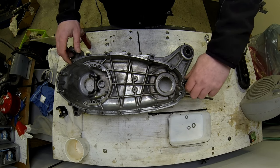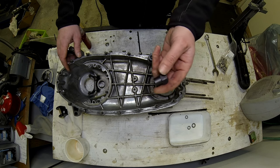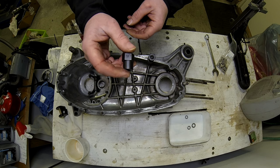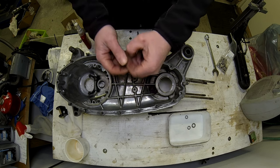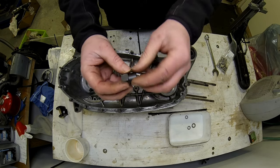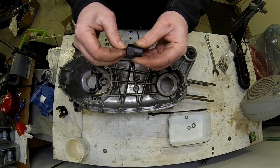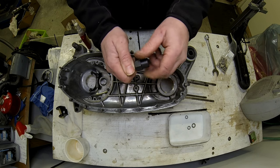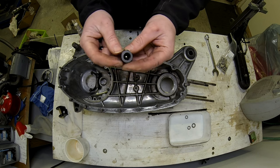And what I use is these fancy gadgets here, which are stud extractors. As you can see, this is an M8. And on this set screw in the top, there's like a ball bearing. So what you do is you wind out the set screw. I can actually show you the bearing. I think that's pinned in. I'm not correct. No, it's sat loose in there.